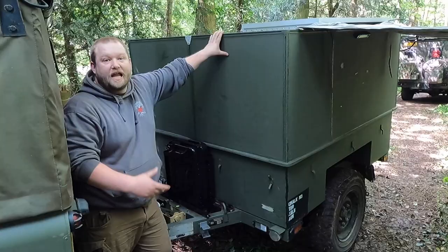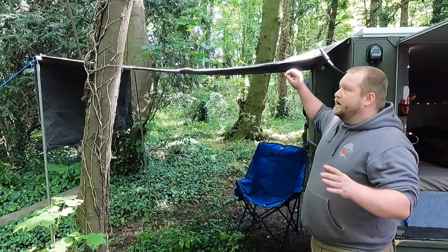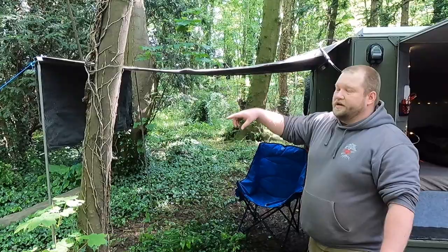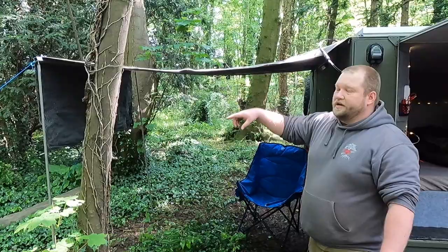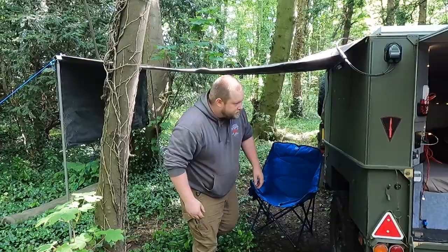On the side I've put a homemade awning — basically a tarp. Wilderness Adventures UK recommended a company called Tarraflex, and they've got some cheap canvases — this is the 17-ounce canvas, about 40 pounds for a sheet that's eight by ten. It's bolted to the rails at the top with an aluminium box section at the end to keep it rigid, with stands and an extra section if I need some extra distance. It also keeps the wind off when you're underneath.